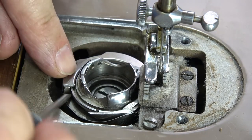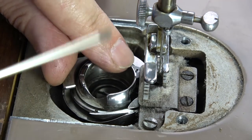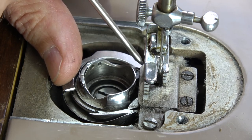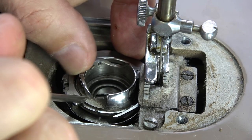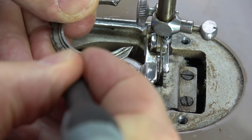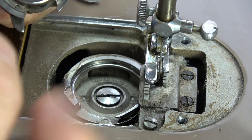You should find you can just about lift this out. Watch out when you do this because there's a little triangular piece of metal that hooks into the underside of the feed dog — when you put it back you need to make sure that goes back in. It's coming — yes, it's out. It's got actual debris and fabric crud under here, no oil at all. Lift out the bobbin carrier itself — it's quite clean actually.